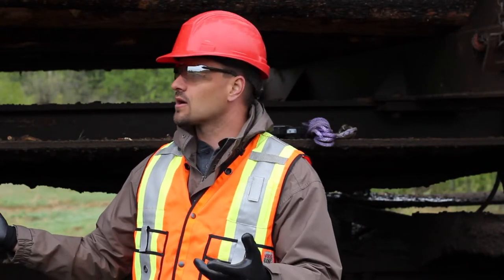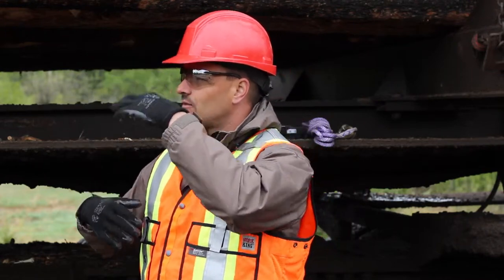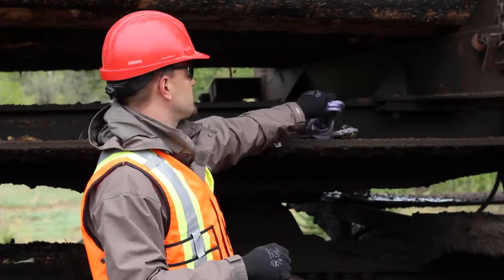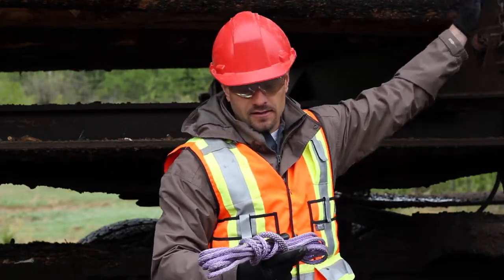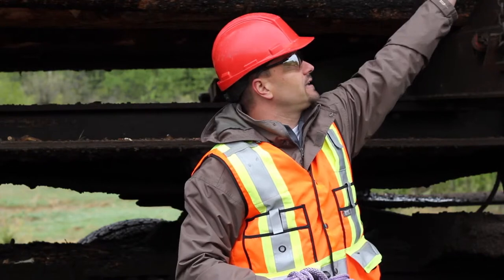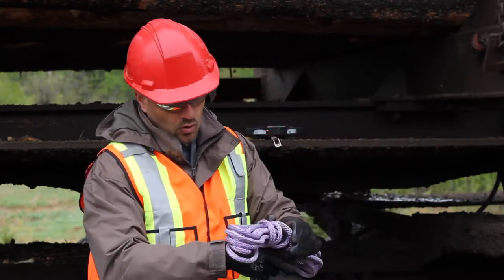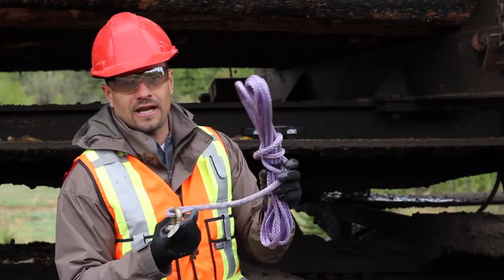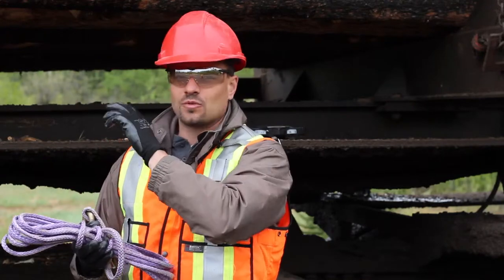On the Pinto Cutacross, Weyerhaeuser would tell you the width, height, and weights on the axle groups. With your cargo securement device — this truck has the new synthetic style — you have to have a tag. Many will have an orange or red tag with a working load limit; on this style it's a steel tag. You need a minimum of three, and these three devices have to secure at least one-sixth of the load weight.